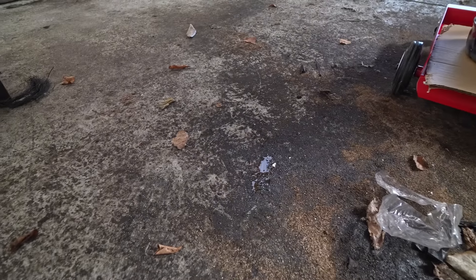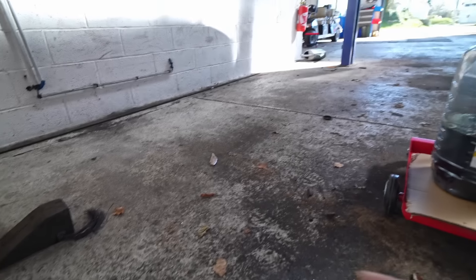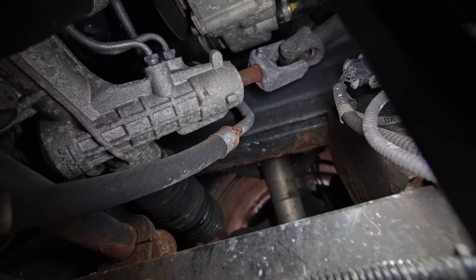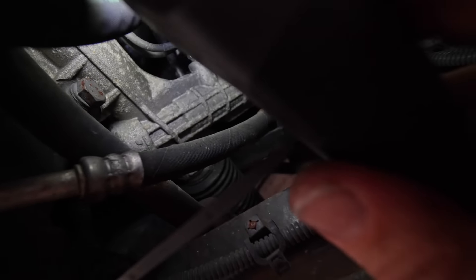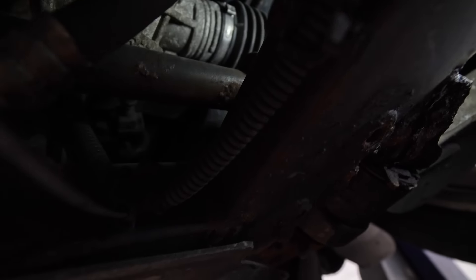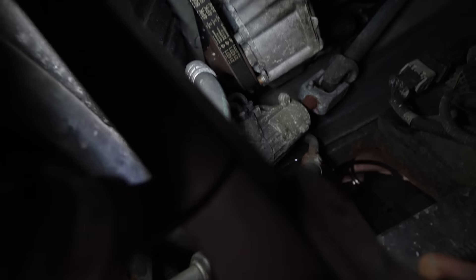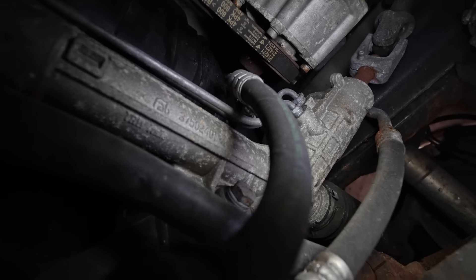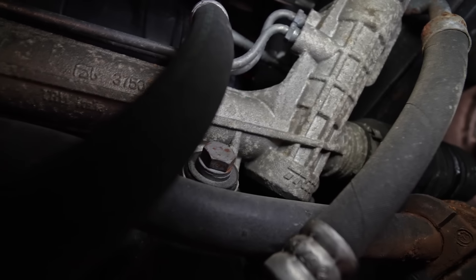What's that? Looking from directly above — we have coolant dripping, and it's coming down. But where it's coming from is another matter, because it's hitting a chassis rail and moving along it, going around that. There's a bit of rust there and marks all over. There's probably a pipe with a small split. That's not too bad actually — it's from the expansion tank. Worst place for an oil filter ever — it goes straight onto part of the subframe.